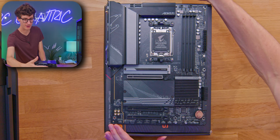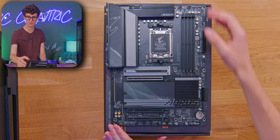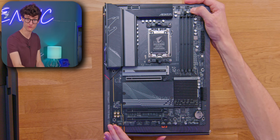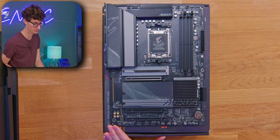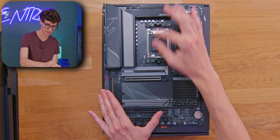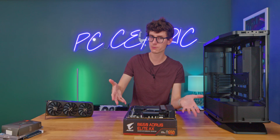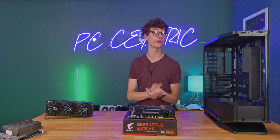We have our CPU power at the top here, our ATX power on the right. We have our RAM slots, of which we want to use slots 2 and 4. So let's open these up now so that we don't forget. CPU is going to go here. If we need to remove the mounting, then it's this bit here, depending on the cooler that we're going for. Sometimes it will use these pre-fitted bits. Other times we'll have to replace these, but don't worry, it is very simple.